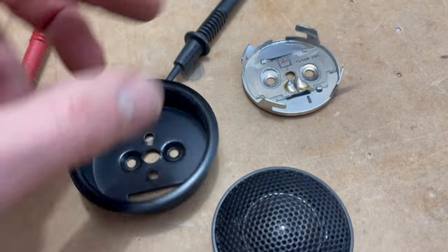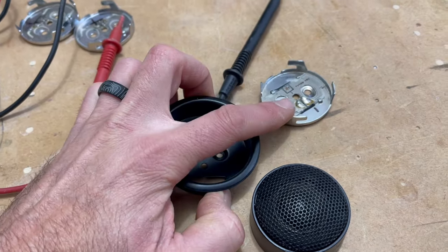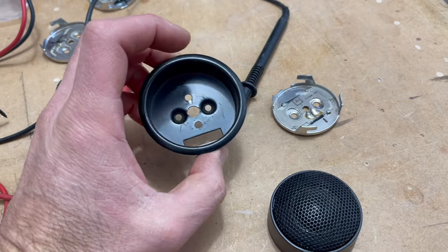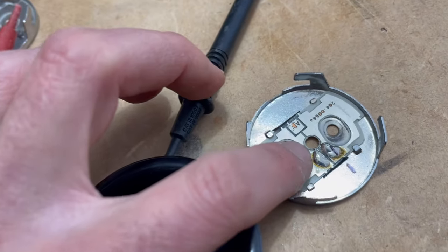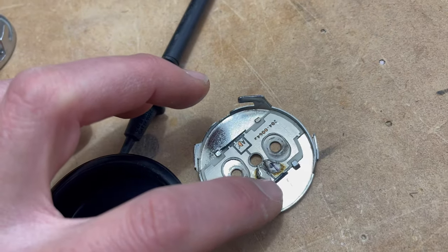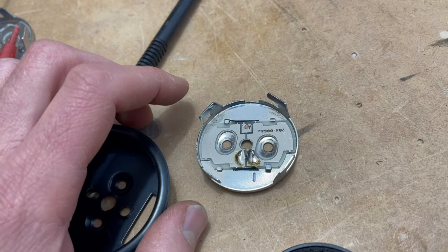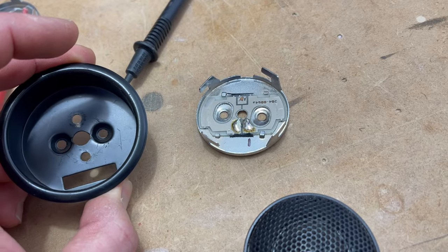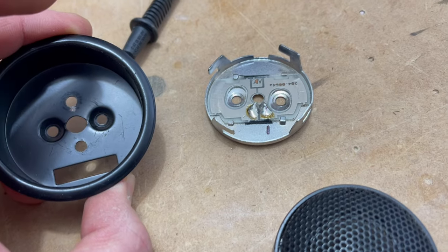Okay, plan B, I'm not gonna route the wires through those holes because they actually hold the speaker to the housing with hardware, which is what we want, so it doesn't vibrate apart. I really don't like this tiny little hole. There's not even room to make a fake grommet with epoxy. So I'm going to drill a hole there with the step bit, big enough to get the new cabling in, and also a little extra oversized to fill it with some epoxy putty to work as sort of a grommet. I could go buy some, but I've got epoxy putty here, so that's what I'm gonna use.